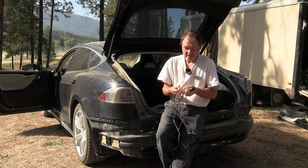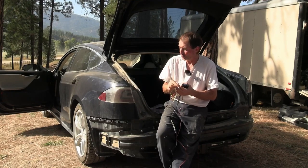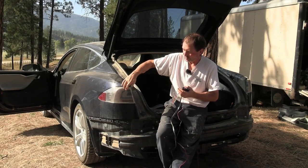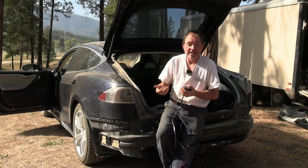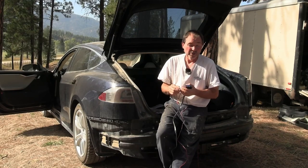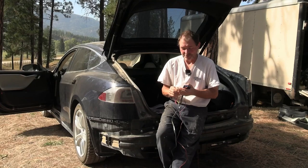As soon as I set the turn signal to the left, my tail lights will flash, because the tail light wire that comes from the body control module and goes to here makes this outer ring flash as well, which creates all my lights on the trailer to flash.